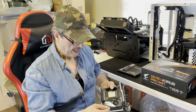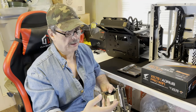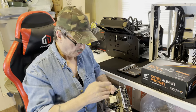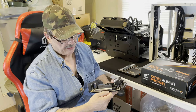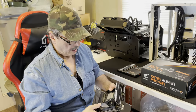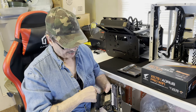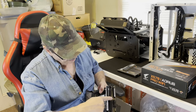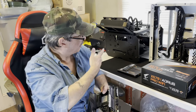Okay, now this versus the ASRock. This is 8 and 2 with a higher count, as far as I think the volts or the amps go, versus the ASRock's 6 and 2. It's better there. It's got 8 layers on the PCB and two layers of copper. Can't compare it. It has four SATAs. It has two system fan headers, which you can turn into 20 with a hub or some extensions. The front I/O I like, which I probably won't be using much, but it's all color-coded. It's very easy to find your stuff versus the ASRock.